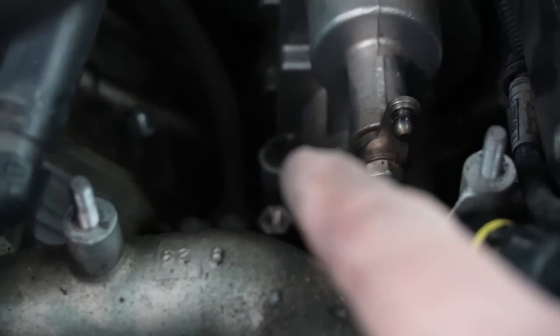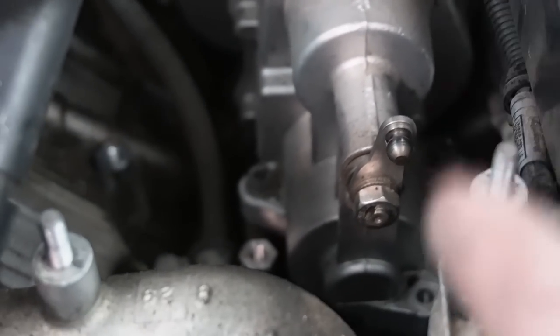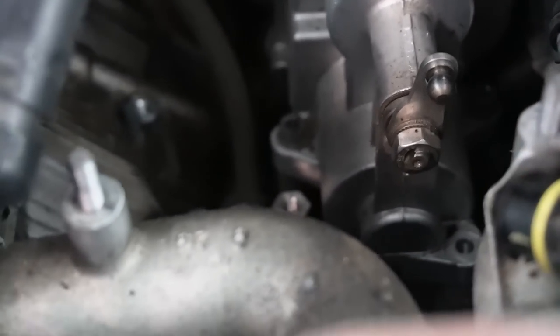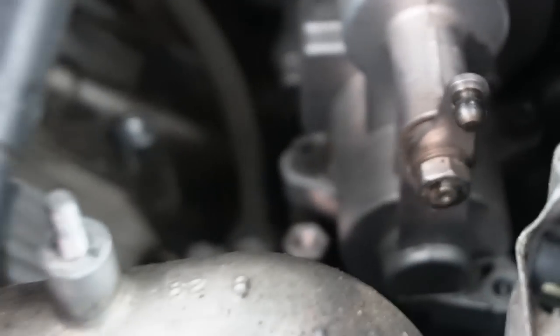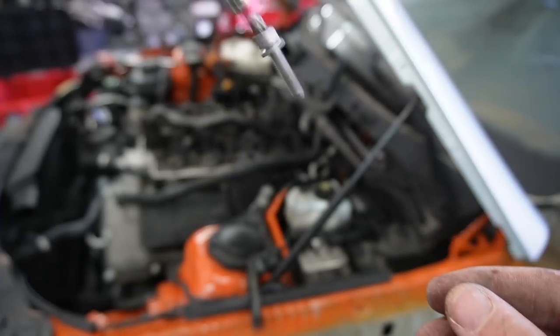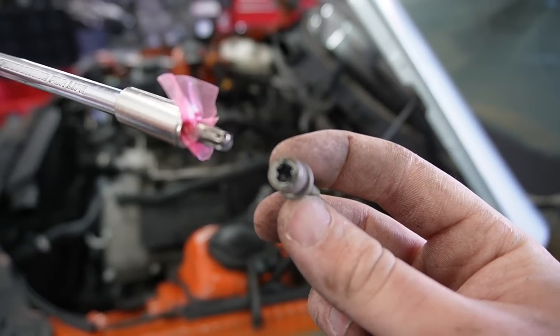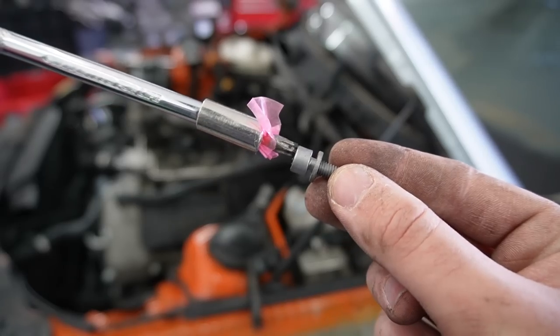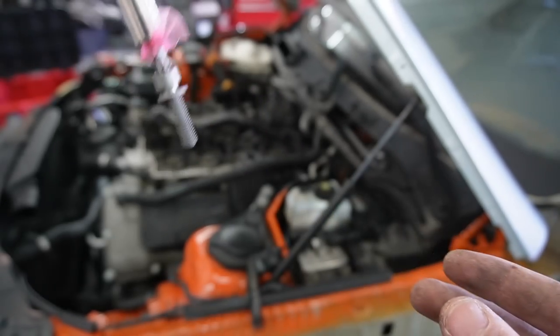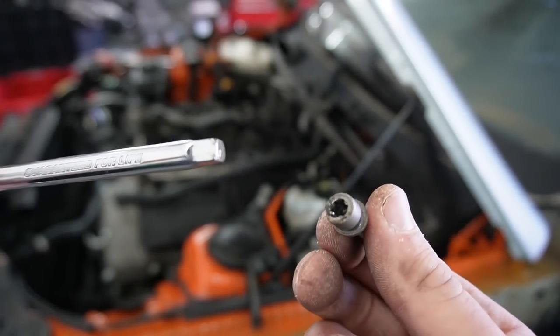I think I found out the issue — there's a bunch of silicone on top of the two screws over here. That basically means this actuator was probably replaced or at least removed for testing at some point. So that leads me to believe this one is bad. When I pulled the second screw out, it was stuck. Whatever they did — maybe they put that gunk on there and put the screw in — this is definitely not OEM and was messed with at some point.